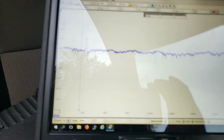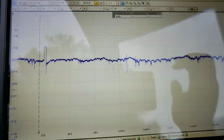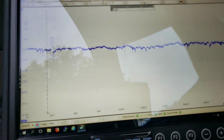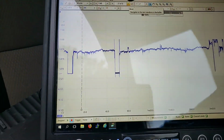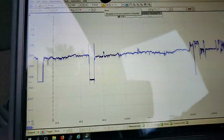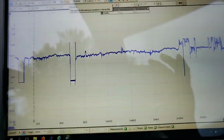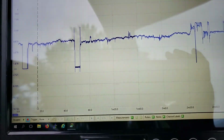When I played around with things, whether I tapped it very quickly to power or anything like that, it would always seem to come back to around this voltage with all the modules disconnected. With them connected in there, it would be down about 6.5. So this is me tapping it down to ground again and seeing whether it would just jump right back up, and it did. As I continued on, I realized this line was not just any old voltage. Obviously it had to be feeding into our PCI bus somewhere along the way.